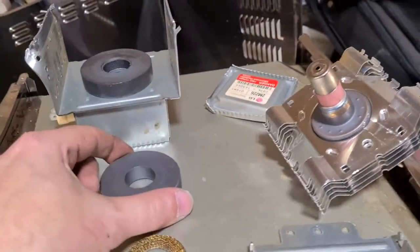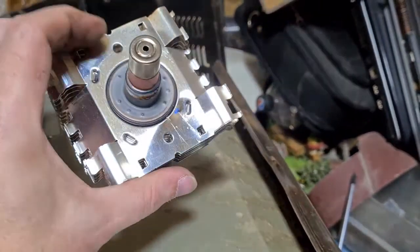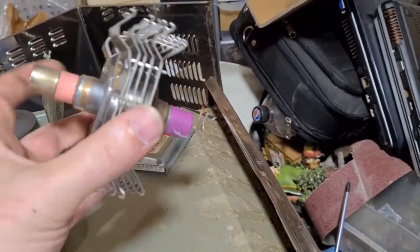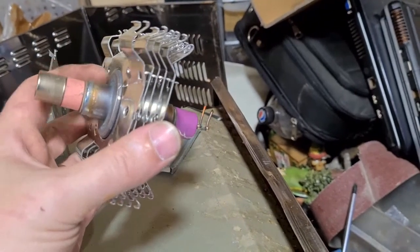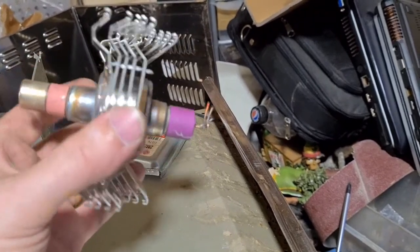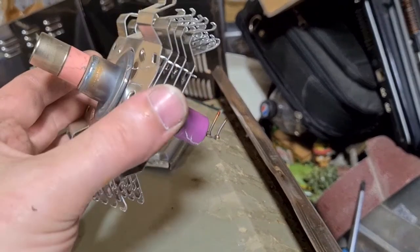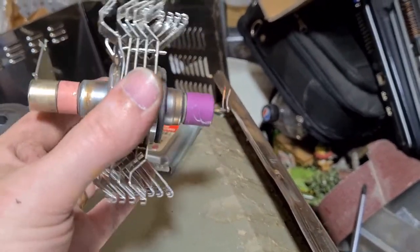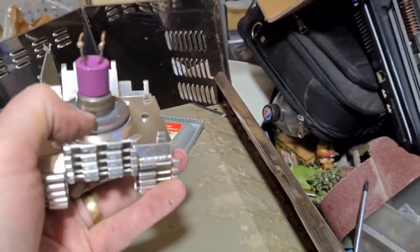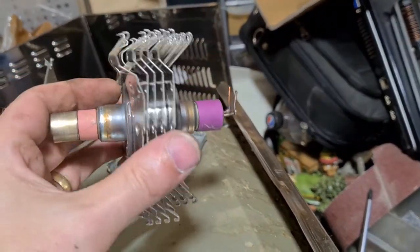Okay, so on taking the top magnet off, it releases this component, and as I say, these fins are all aluminium, so we will extract them from this piece. The centre of this piece is copper, but just make sure you don't mess around with this kind of stuff. Don't be shattering that, keep that intact, and certainly I wouldn't try and recover anything from that area. But you can grind off these bits, cut through that bit and keep this bit which has copper all the way through it.